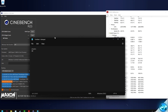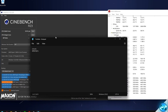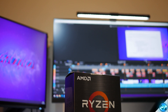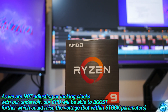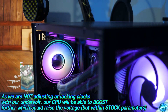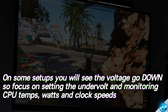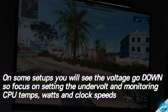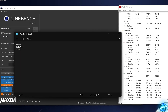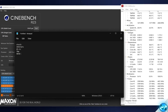Your Cinebench score will be completely different depending on your CPU and stock settings. Also note the voltage utilized throughout the test. It's not super important due to the way Ryzen CPUs boost — during an undervolt, you may actually see voltage go higher, which sounds counterintuitive but is due to how Ryzen CPUs work. The CPU could be utilizing more voltage to boost core clocks higher, giving better performance while reducing overall power in watts and keeping the same or lower temperatures. Note the maximum CPU package temperature — 69.1°C for me — package power at 78 watts, and core clocks from 4050 to 4100 MHz under load.